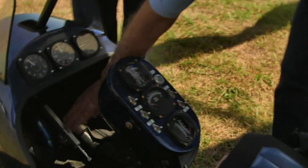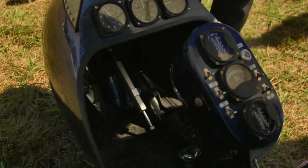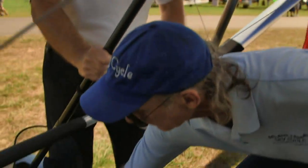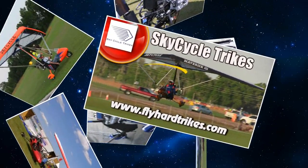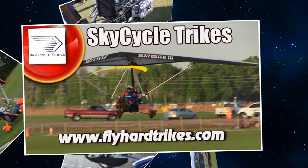I also started putting a front wheel steering stabilizer on there. That's what the strut I'm seeing right down there is. Now what does that do for us, Mike? You can turn that knob on the end of it right here, and that'll tighten the steering. So it's adjustable — not just dampening, but it adjusts. You can loosen it up or tighten it up and make that wheel not move at all.